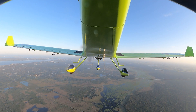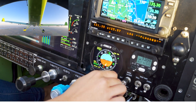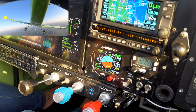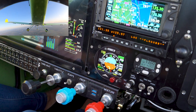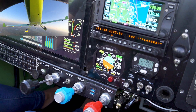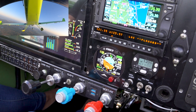Autopilot is active, maintaining our present heading and present altitude. We can also change our heading using the heading knob and it's going to hold our current altitude. Now I'm going to the right, and if I want to go to the left — let's say heading 140 — it will do that too, while holding the altitude.